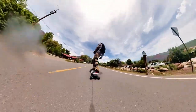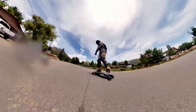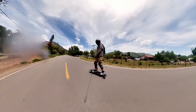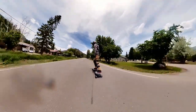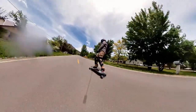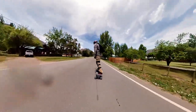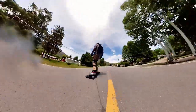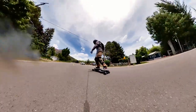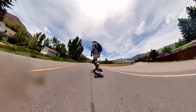The board was noticeably smoother and jittered much less with the 110-millimeter wheels on. If you're looking at this board and you ride wet or rough roads, those are a perfect fit. They are also basically the largest wheels you can fit on this board without removing the belt guard — anything above that risks scraping, with only about a 2-millimeter gap.